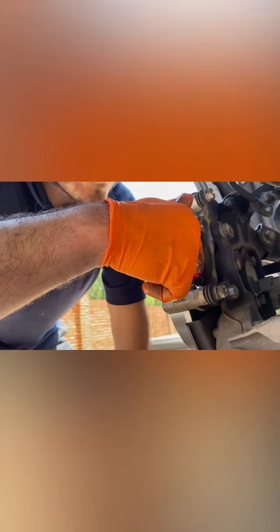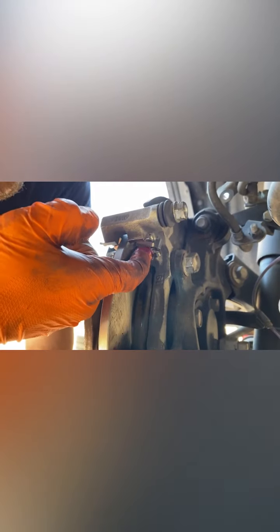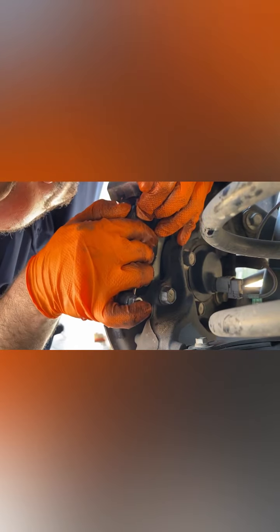And always put grease on your hardware, right in there, top. Same thing on the other side. All right, so now just line it up. And you should just be able to slide in there. Okay, this one slides in there. This one's in there. Voila. So now we get the other brake pad. Same thing. Grease there, there. Make sure it's lined up. All right, we're done on that side.